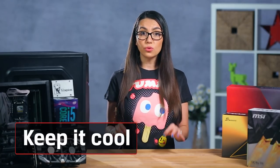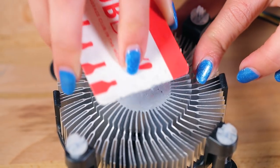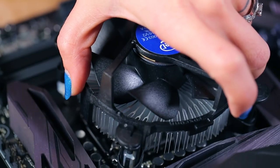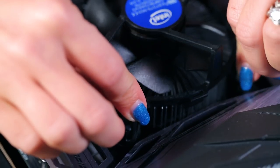Now for the cooling. If your cooling solution already has a thermal compound applied, fantastic! If not, use just a wee bit and spread it around evenly — using the edge of a credit card may help. If you are using a thermal pad that came with your cooler, remove any protective tape from the die just before installing and be sure not to get it dirty. Don't try to use the thermal pad and thermal compound together — it's one or the other. Once you've got the thermal compound figured out, align the support posts for the cooler around the socket and secure everything into place. Refer to your cooler instructions for exact directions because this will differ from model to model.